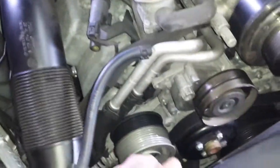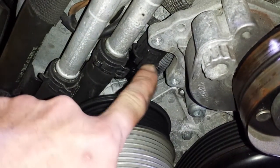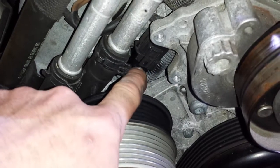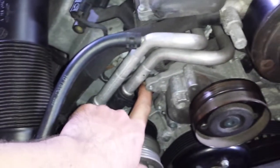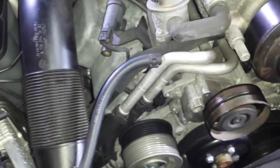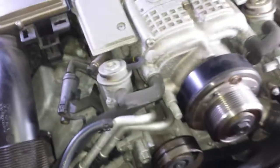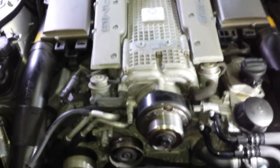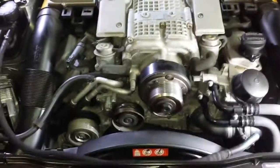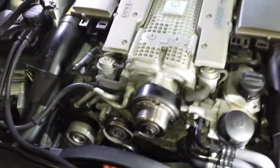Other than that the car is nice and everything else seems to be in order. The sensor is brand new — you can see the color of the plastic. This is something that codes kept coming back for — an open circuit on the sensor — so we replaced the sensor and brackets. Everything will go back in once I'm done with these pulleys. This is a supercharger on the 5.5-liter AMG motor, very common — found in lots of E-Class, SL55s, S55s — the M113 with a blower on it.